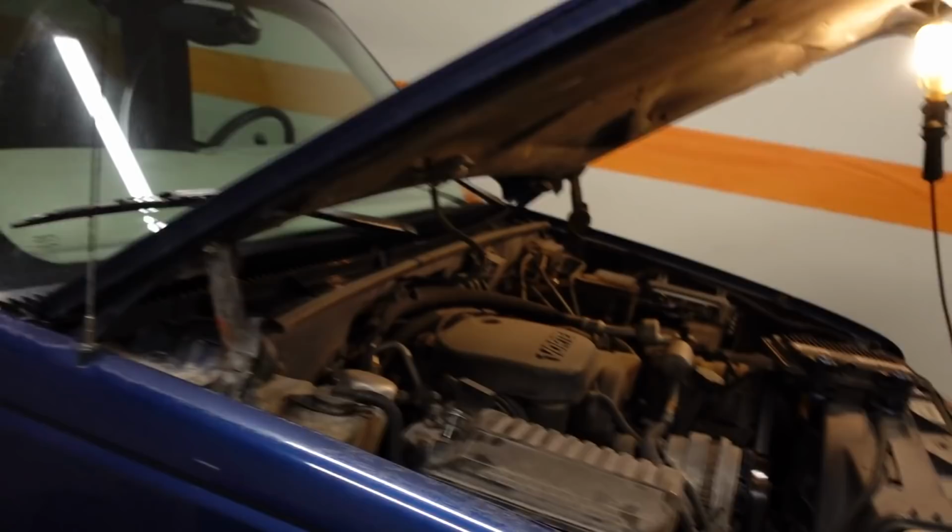So that's where we're going to start, rather. We're going to find an '01 or an '02 Express L31 tune file, and we're going to work with that and modify it to actually be able to run this Suburban. And we might have to make a few tweaks. Maybe we'll borrow parts of a VE table from an 8.1, things like that. But I'll just show you all the steps that we're going to take.